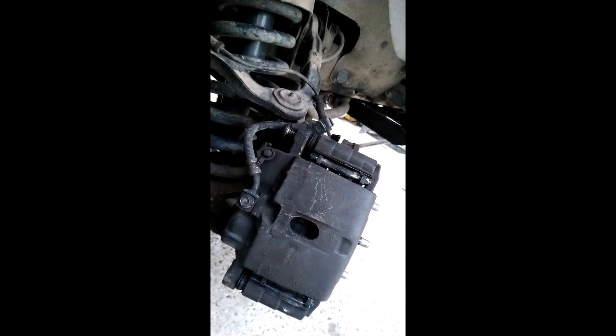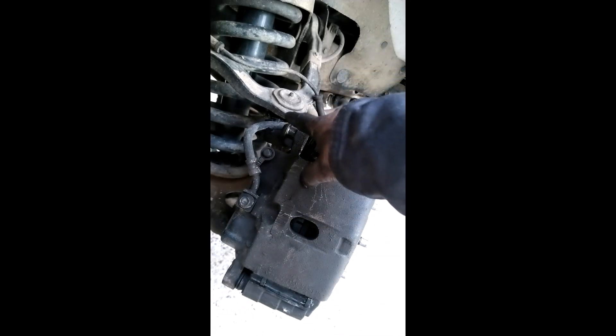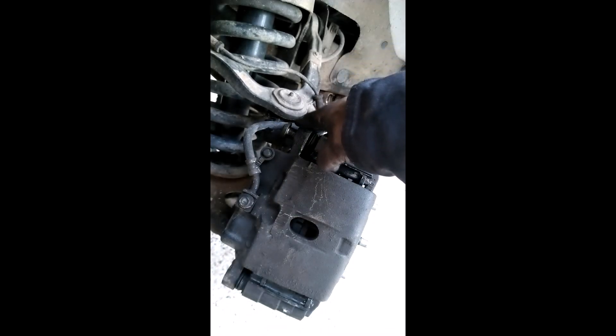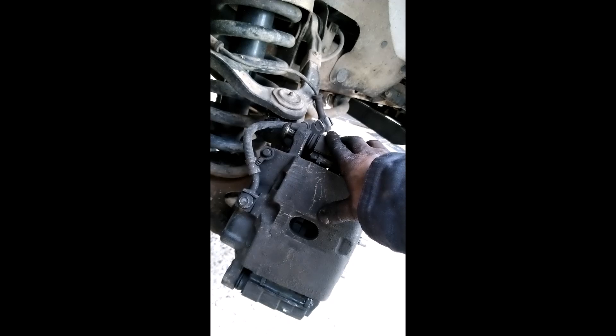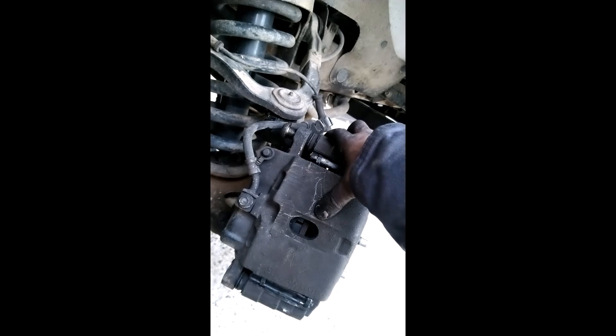You can see how the caliper is now sitting on the brake pads. This is the top bolt and this one here is the second bolt. Put some grease on both bolts. Then push that bolt in — you can see the thread is all the way up here — push it in, push the bottom one in and screw them back in. Remember the master cylinder is open, so when we were compressing the caliper we didn't mess up any brake lines — I was checking and nothing is leaking because we opened the master cylinder. Now put the bolts back in — lock that top bolt and then lock this lower bolt.